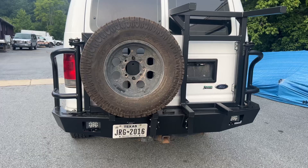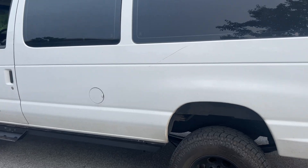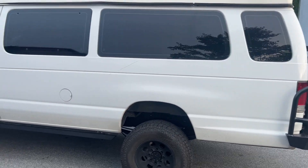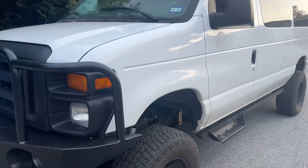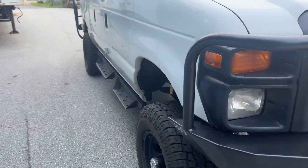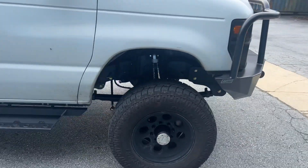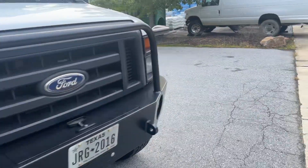Out back we've got an Illuminous bumper with some LED lights — turned out super nice. So the RSC light is off, the ABS light is off, the TPMS is reprogrammed. All that's left is an airbag light; it has something to do with the passenger seat. We checked the wiring real quick and there's nothing there. The ABS module had been unplugged, in hopes of turning off the light or disabling that system, but that didn't work. So we replugged the ABS module and all is good. Here's our passenger side step, and yeah, this thing's ready — it's at the road miles stage right now, so we're just going to keep putting miles on it and let him come pick it up soon.